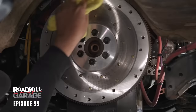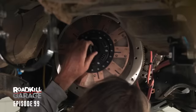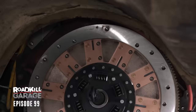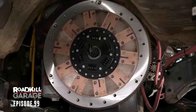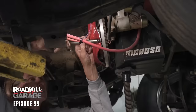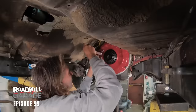We're going to borrow a clutch alignment tool and put the whole thing back together. Check out this flywheel — it's aluminum. The thing is, the aluminum flywheel is lighter. A steel flywheel that's heavier has more stored energy in it for the launch at the drag strip, whereas this doesn't, making it more of a hair trigger on the launch. But the engine doesn't have to accelerate as much mass, so it literally makes more horsepower because it doesn't have that parasitic loss.